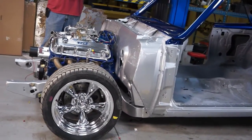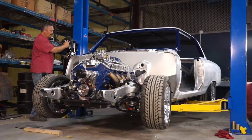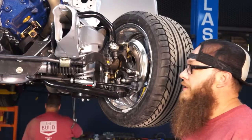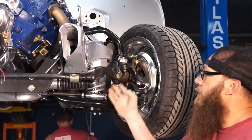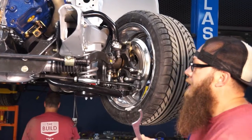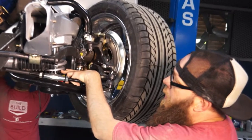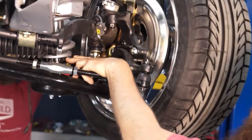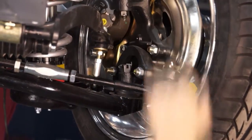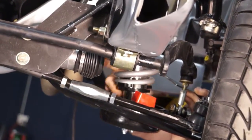We've got to at least make it over a speed bump. What I'm getting ready to do here is move our springs up on our adjustable shocks. The way you do that is you take this wrench that they provide in the kit and you'll have to loosen this bottom lock bolt and then tighten up the stop for the spring. So that raises the spring up and in turn raises the front of the car up. Start with loosening the lock bolt and then tightening the stop bolt.